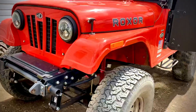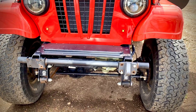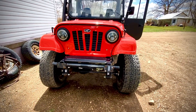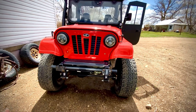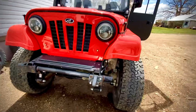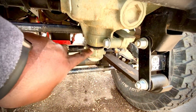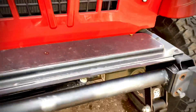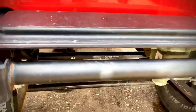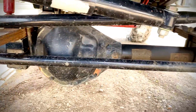So far it's been pretty good, but I've been having issues with the alignment up front and I'll try to take a look at that today. It looks like I have too much toe-in, so what I will do is when I get into the shop, I'll get this aligned, take off the bar that connects both arms, get everything straightened up, then get the bar back on and go from there.